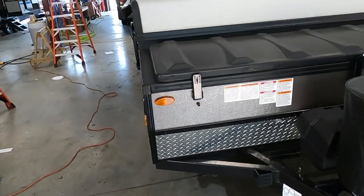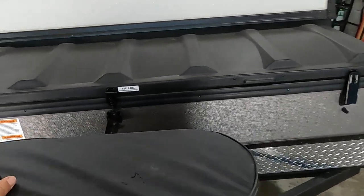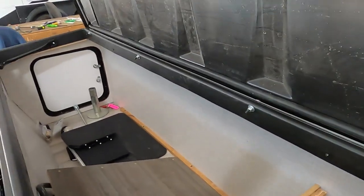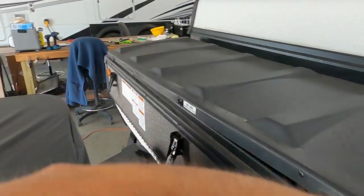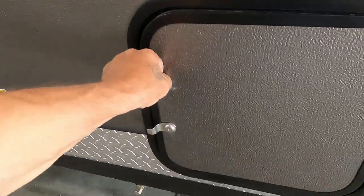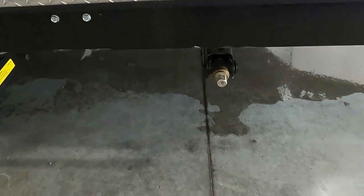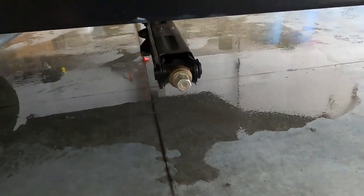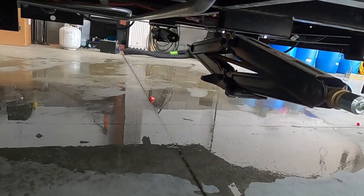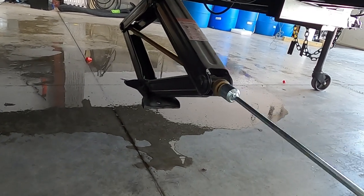Your hand crank is up here in your storage and is also accessible from the side door. Before bringing the stabilizing jacks down, I recommend using stabilizing jack pads. Jack pads will protect the feet of your stabilizing jacks from dirt, debris, and hot blacktop in the summer — a good investment. Use your ten percent off coupon, grab a four-pack, and put them down underneath.